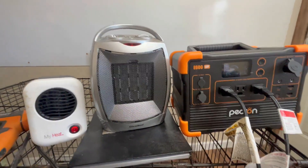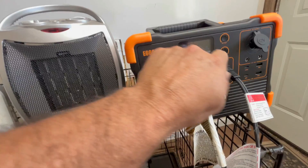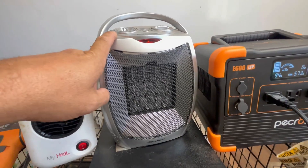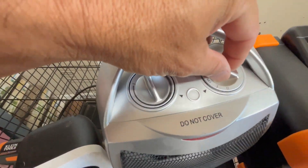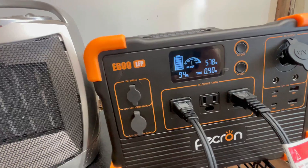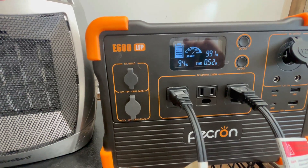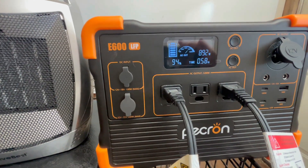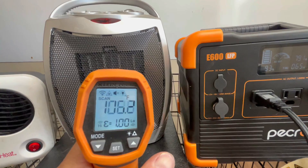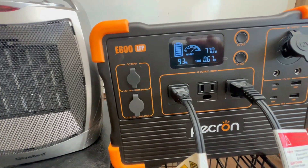Let's see if this unit can power a space heater. This one is rated at 1,500 watts, which is too much since this unit maxes out at 1,200 watts — but it has a half setting at 750–800 watts, so let's try that. Running at the number one position, it starts pulling about 800 watts and spikes up to about 1,000–1,100 watts. It handled that 1,100-watt surge without a problem. It's really blowing hot air and performing fine, settling around 770 watts.